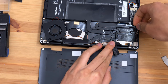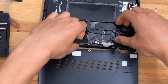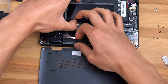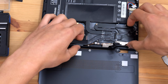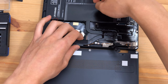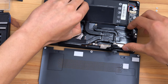With that sticker removed, we may be able to simply lift the heatsink assembly. This appears to be a little bit stuck, so we'll try to wiggle that loose. The heatsink is stuck quite firmly. You want to be careful because this is very thin material — you don't want to pull on these radiator components very hard at all to avoid bending the assembly more than necessary.